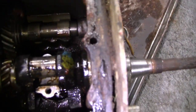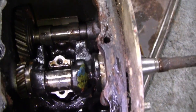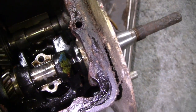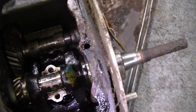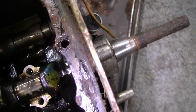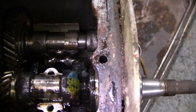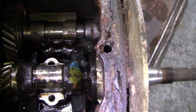I got the connecting rod — the bottom connecting rod — off and everything like that. You see the crank is moving, so that's not what was seizing it up. The camshaft is moving nice. I had it up on a vise already and I was hitting it pretty good with a block of wood and a hammer, and that piston wasn't moving at all. So I turned it upside down, squirted some oil down on the edge of the piston, and I'm gonna let that soak overnight. Then I'll try hitting it with the hammer again — if I get a little movement out of it, it'll come out.